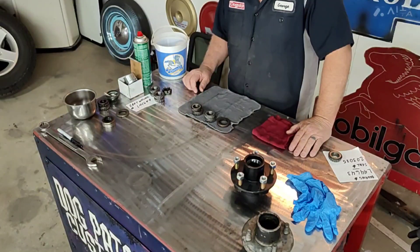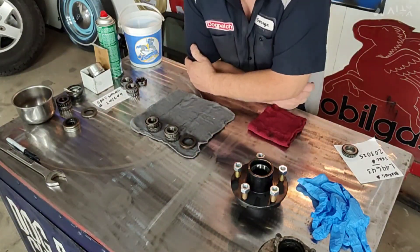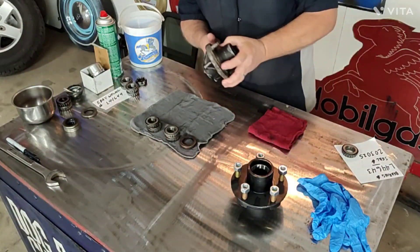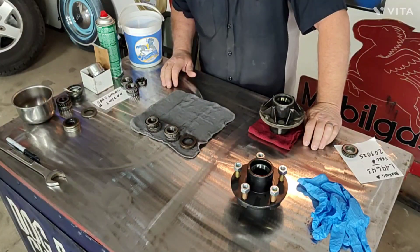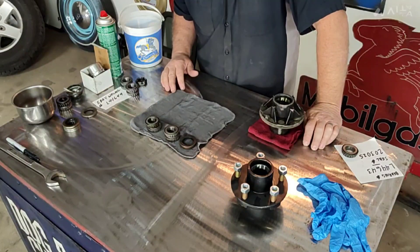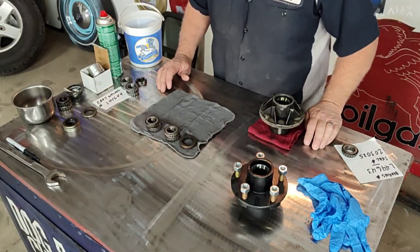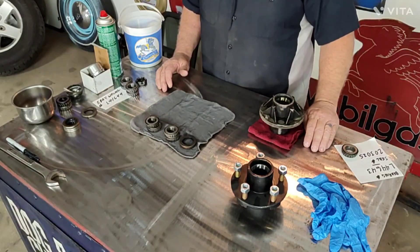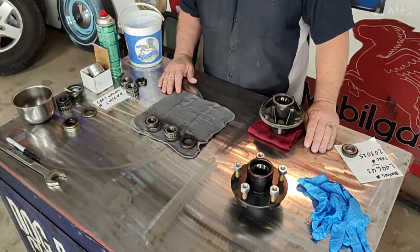Cheap do-it-yourself $20 upgrade that'll just make it look outstanding when done. We're working on 2,000 pound axles and hubs - a lot of your teardrops and smaller campers and square drops run these, similar to what you get from a Harbor Freight trailer or the smaller landscaping trailers at the big box stores like Tractor Supply. Little 5x8s, 4x8s, or even 5x10s are running the small 2,000 pound axle. Be honest - if your trailer weighs 800 to 1,000 pounds, you're not going to load it with another 1,000 pounds of stuff anyway, so the 2,000 pound axle does great.